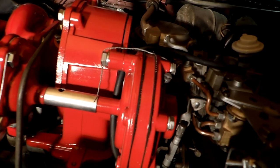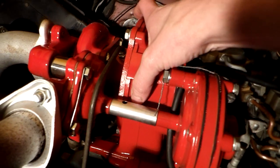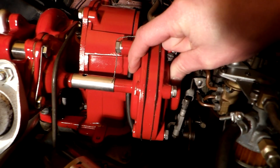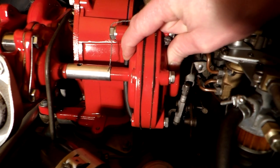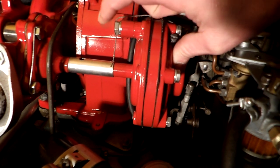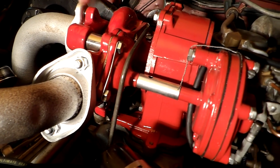That's for the most part how the system works. The turbo itself works like pretty much any other modern turbo — you've got your compressor and your turbine, and a controller that's a spring diaphragm with shims. Depending on how much the spring is shimmed, the right amount of shims will give you five to six and a half pounds of boost — they like to get closer to six to six and a half. If you go over the shimmed amount, it will open a valve to allow the exhaust gas to bypass the turbo.